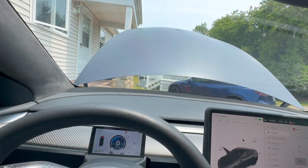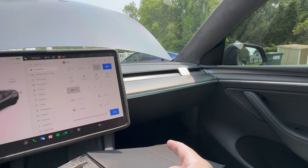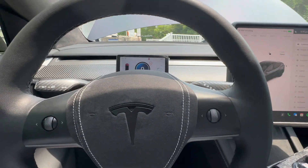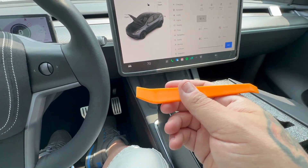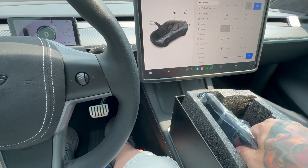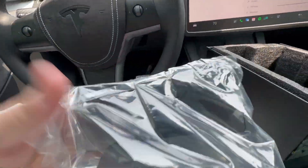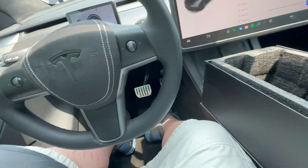You can mount the camera on the front. I had my frunk open to see how easy it would be to pass through the firewall and get down there - seems pretty easy. Got to cut a little hole in a grommet, but it seems very doable and not too much has to be removed. Let's see what else is in the box. We get a spudger - those technical items - and the unit itself, which is very well packed. Han Show's presentation is always amazing.